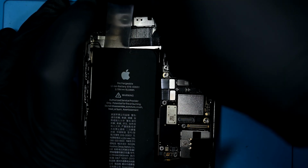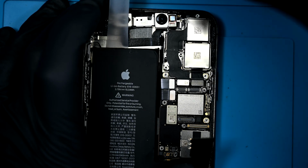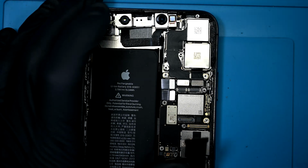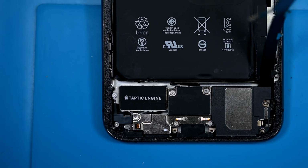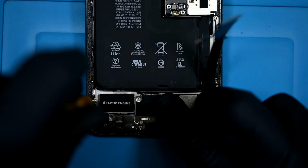I mean, when they don't tear. If they do, heat and alcohol seem to be the best solution. It's a good idea not to bend battery cells with tweezers or metal tools. And the bottom one's ripped, of course. I'll use alcohol in the heat mat of shame.